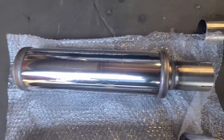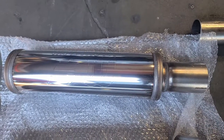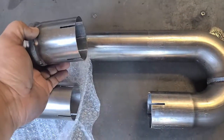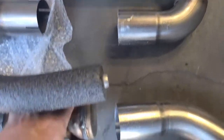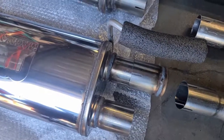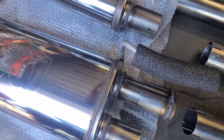We can tune out the unwanted drone sounds by reproducing them. This is where the cap comes into play. You can insert it here or cap it off at the back of the muffler, depending upon how much drone cancellation, or which frequency, you want to cancel. As you upgrade things, such as larger tires, different gear ratios, or increased load from the weight we're putting in the vehicle, you'll find you want to fine tune that using the different features we've provided.